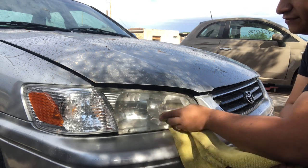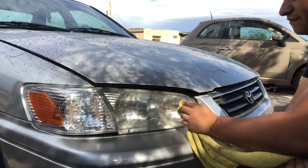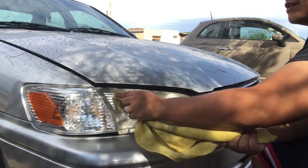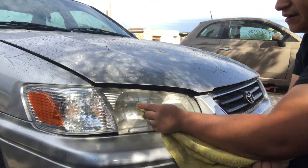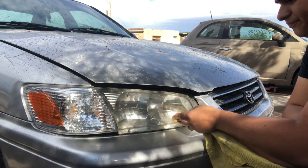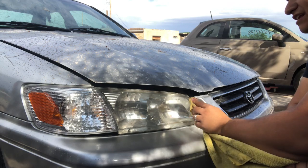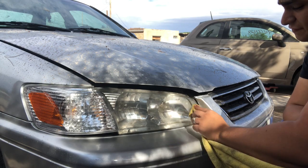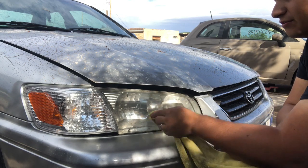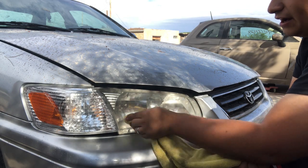After that you don't have to sand it again — you'll just need to buff it, unless you find something to protect it for even longer. I've seen people applying clear coat onto their headlights, but you'd need to find the right clear coat for plastic that is also high-heat resistant, because depending on what lights you have, it can get really hot.